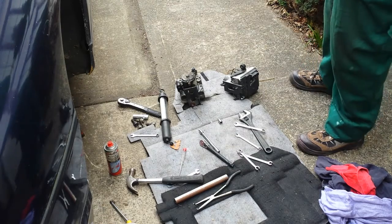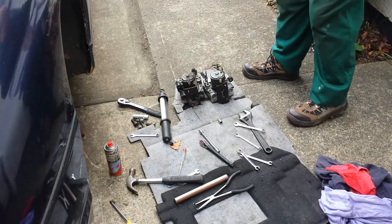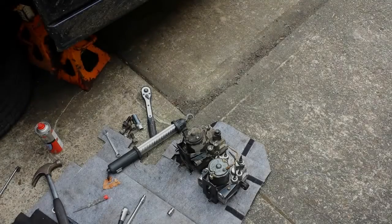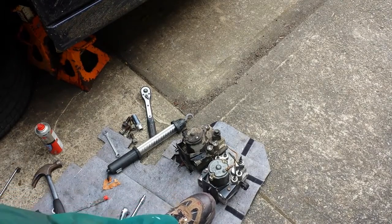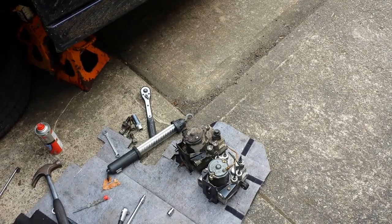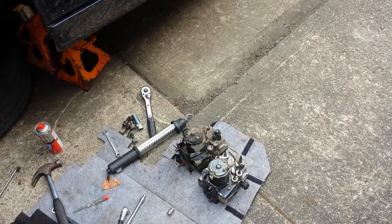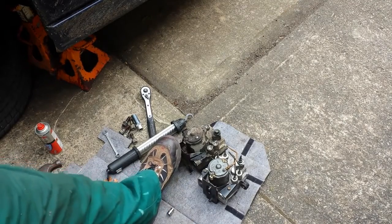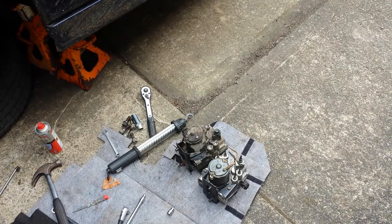Done some looking around and a bit of research over the past few months, and got myself a pump here. The pump on the right, or lower down in the frame, is basically out of an E39 525 diesel. It's the exact same Bosch and BMW part number as the E31 part. The electrical and the hydraulic fittings are the exact same. The only difference is in the mounting bracket, which we're just going to swap over from the old pump to the replacement.